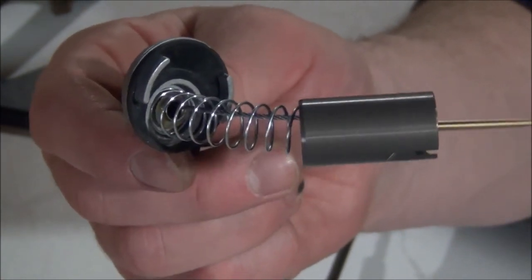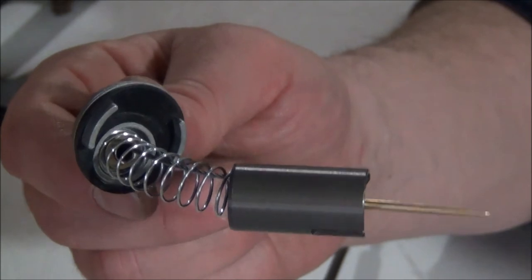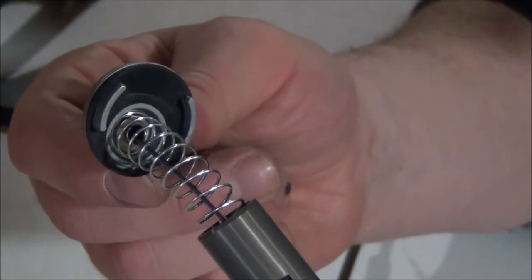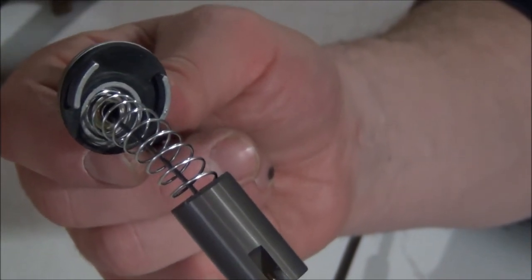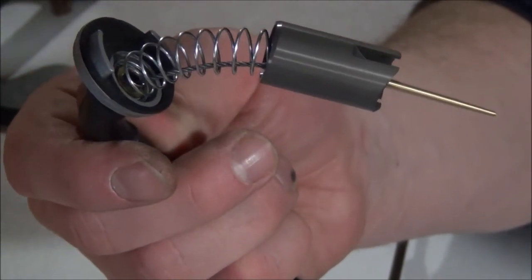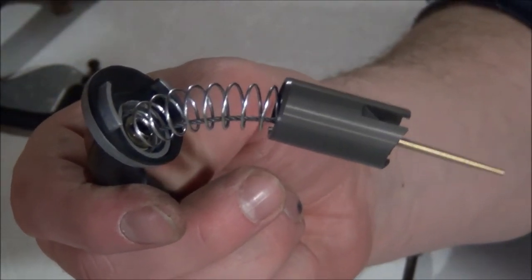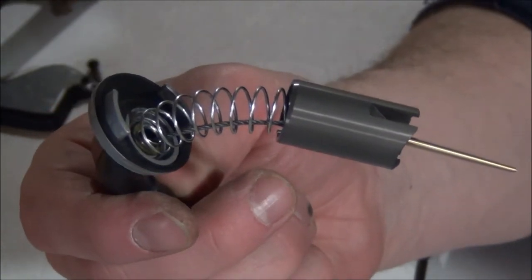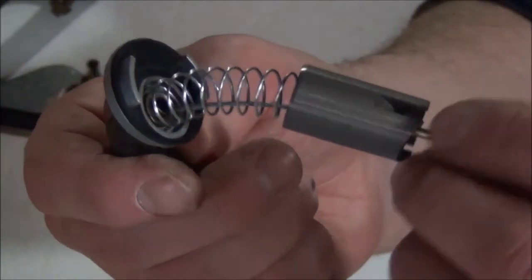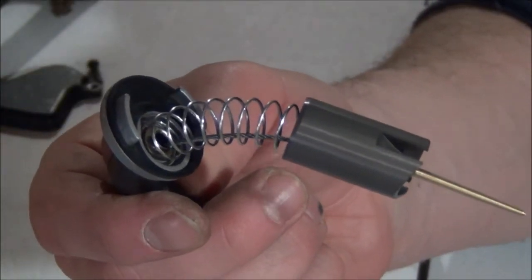Once I started changing everything out, it's like you change one thing, you have to keep changing everything. You can't just put on a new kill switch, because the previous kill switch had the throttle body or the choke on it. So if you remove that, there was no way to attach the choke unless you wanted to cut it and pull it from the edge of the carb, which you could definitely do. That's what my dirt bike has, just this little tiny pull choke on the edge. So let's get this guy back in place and start buttoning everything up.